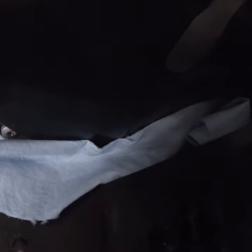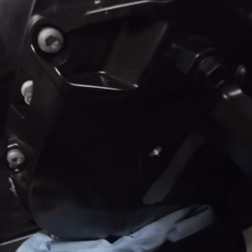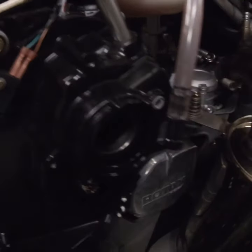I recommend putting a paper towel or shop rag down here at the bottom so that as you start to fill through the fill point and watch the sight plug hole, you have a catch point when the fluid starts to come out. That way it doesn't get on your sled and sit there making a mess. Make sure you put that in there and keep it clean.